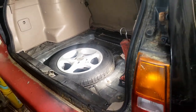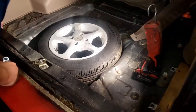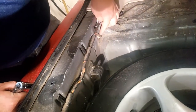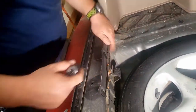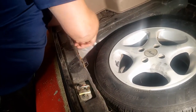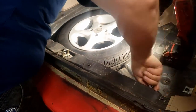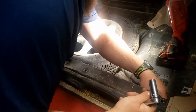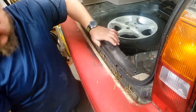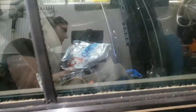It's actually a 14. They took all the junk out, which includes a CRV picnic table — if you didn't know, CRVs have these. I don't know if they still do, but it fits in the back of the Escort along with its full-size spare. There are three bolts total on each side — here's one, it's a stud so nut. And then there are two more for each side on the bottom. I'm going to start by loosening them, then go to the other side while she takes you around.